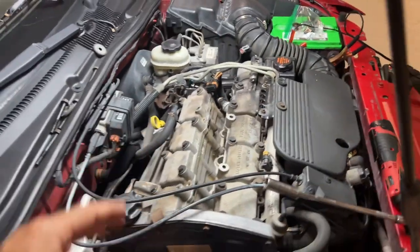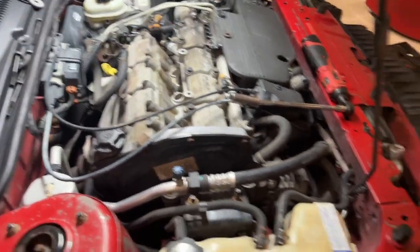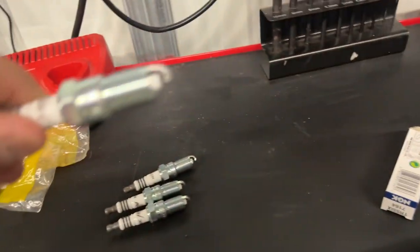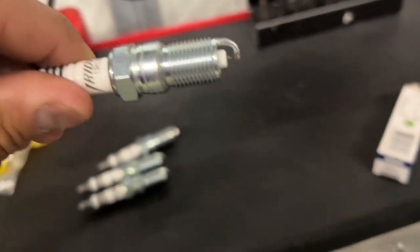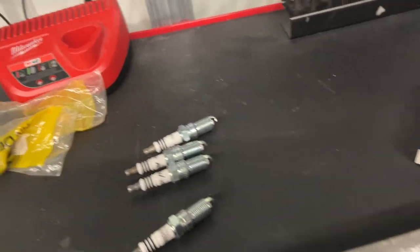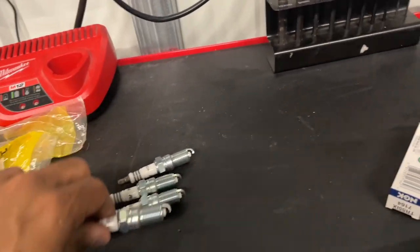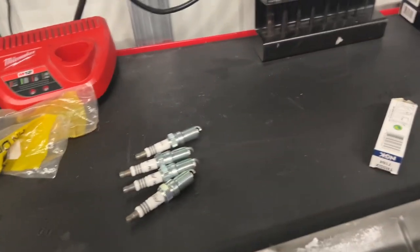Got the cover off, you can see the infamous 2.4. Got all the plugs out and gapped the new ones. The originals are AC Delco Platinum plugs — they look rough. The NGK TR55IX Iridiums are going in. On the iridium side I closed the gap quite a bit — they came out of the box at 60 thou, I've gapped them down to 40 for a better burn and a hotter spark.